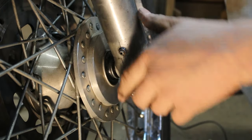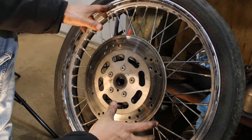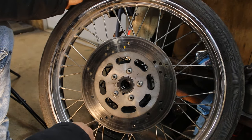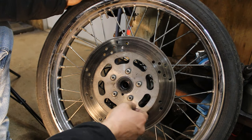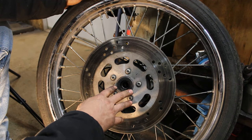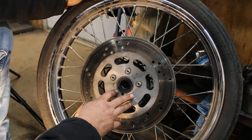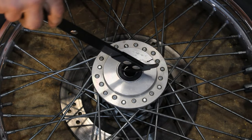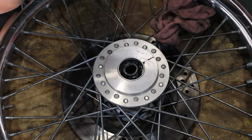Just hold up on the tire and pull it out. Now when you've got the wheel off, you want to go ahead and inspect the roughness of the bearings. Keep in mind if you've got sealed bearings you still want to check the roughness — make sure they're not going out on you, because those things can cause handling problems on the interstate. They call it the tank slapper, and it'll kill you. Let's go ahead and pull out this seal and bearing.